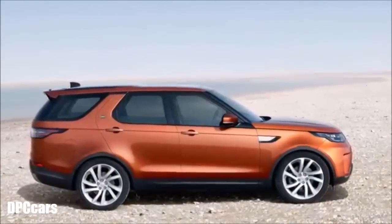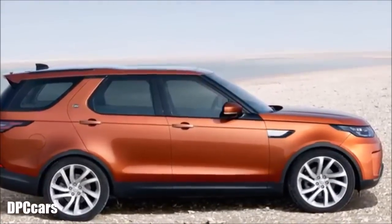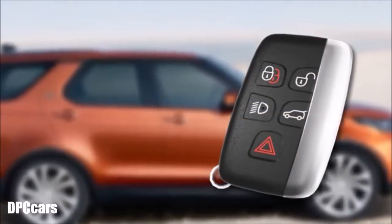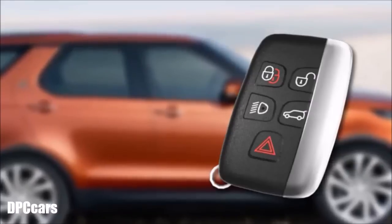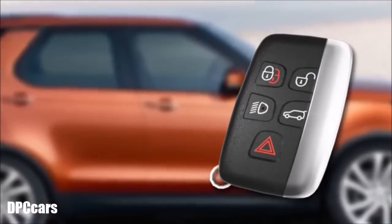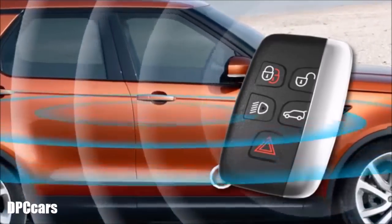This video will show you how the keyless entry feature works and how the keyless locking feature works. Keyless entry allows you to unlock and enter the vehicle without having to press any buttons on the smart key. The key will need to be within 1 meter or 3 feet of the door handle or tailgate release switch for this feature to operate correctly.